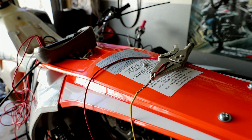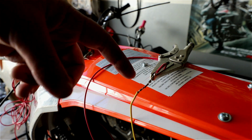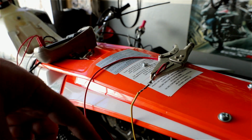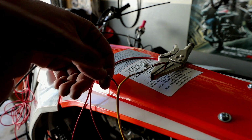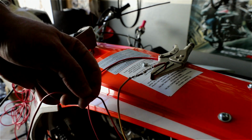So what I'm doing, I just put a resistor in series. I mean, you can go and split the voltage, I guess, depending on the light you have. But I just happened to try it with a resistor, and the light was dim. So I'll do this for my running light. That's going to be for the running, going straight to my connector. And the other one that's on the red, right here, is going to be on my brake. So basically, whenever I hit the brake, I'm just going to bypass this, and it should work, hopefully.